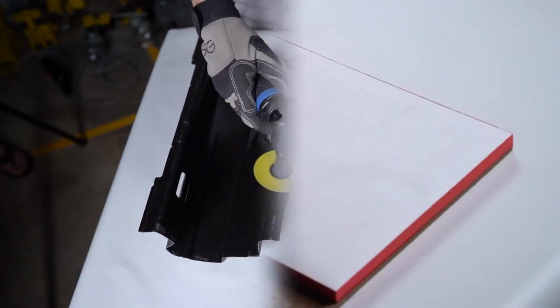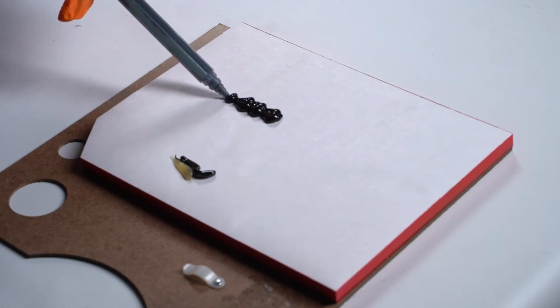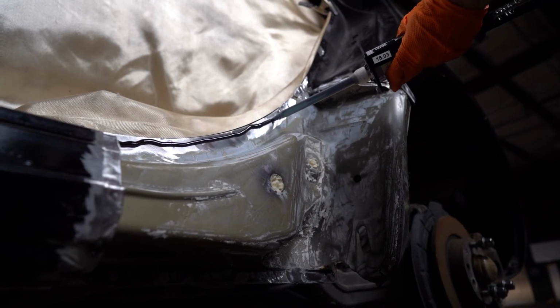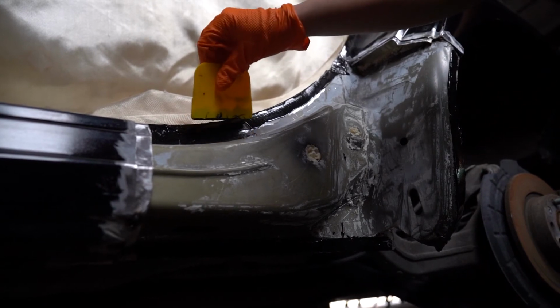After installing the adhesive cartridge in the dispenser, the plungers are leveled and a bead of the adhesive the length of the adhesive tip is dispensed. Next, the adhesive is applied along the entire bond line on the vehicle as well as the replacement panel. Make sure to cover all bare metal by brushing out or spreading the adhesive.